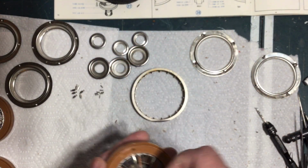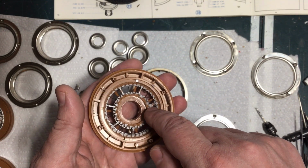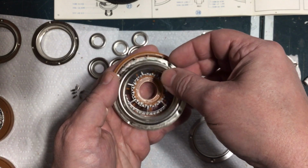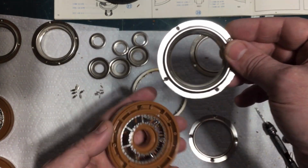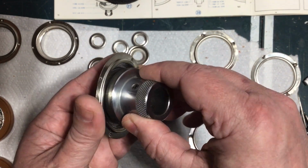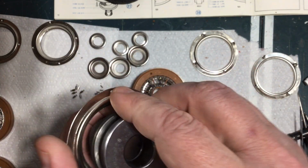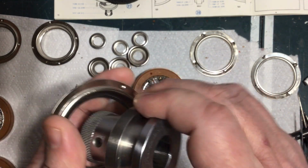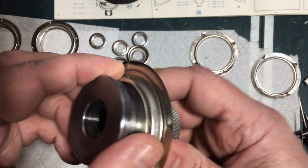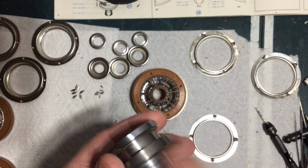And then all you got to do is put all the spokes in the other side. There are 31 or 32 on this side. And then you put this ring on. But of course, the opening of that ring is too small. You got to open it up. And I have, again, another piece of just junk pipe, that one right there. That first opening is the size it is right now. So I hammer that down, and that makes it perfect.